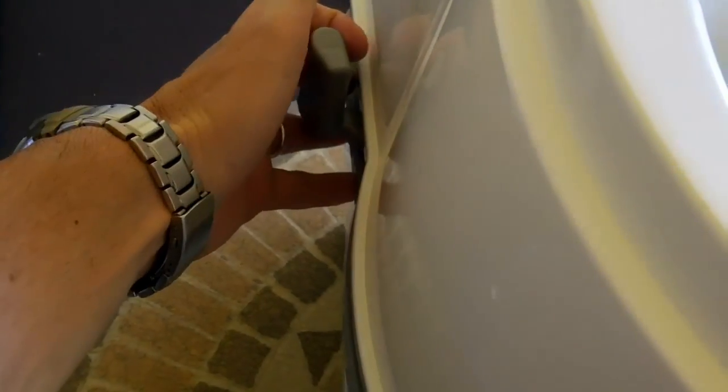and then to flush the toilet, you would pull this lever, and you'll see here what happens when I pull it. The water flushes into the waste tank or holding tank, and then pushing back the lever seals the blade forward, and your tank is now ready for some more fresh water.